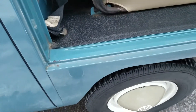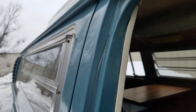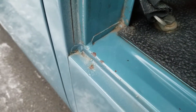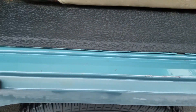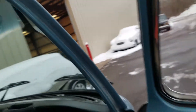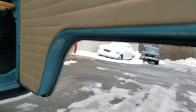Doors open and close real nice. Some evidence of original paint color on the inside, and a little bit of contamination slash surface rust — this has probably been like that for 20 or 30 years. There's a little bit of dry spray, thinner coverage on tops of some of the panel areas. The door jams are real solid. The jams and the pinch welds — everything's real solid, no unusual swelling. Door corners are nice and clean. Bottoms of the door shells are nice and clean. And the sill in the entry area is nice and clean — looks good from both sides.